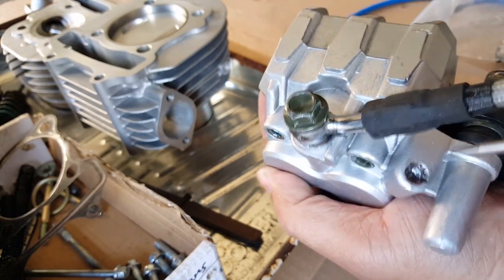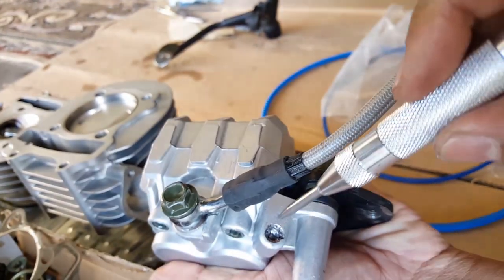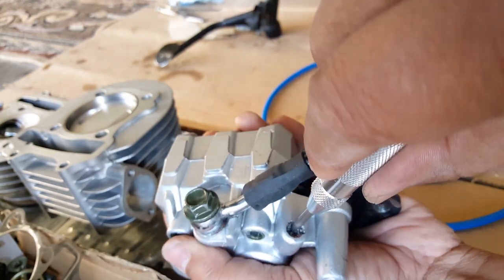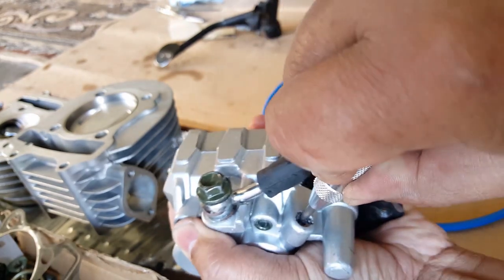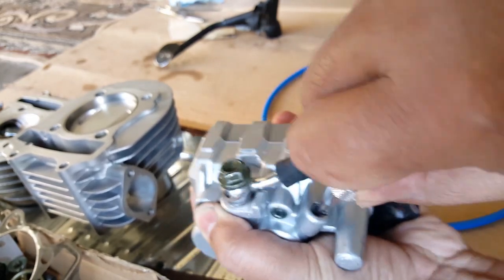But what you would do is, you'll grab a center punch tool like this. I didn't see how useful one is. So you see it retracts back and forth. When you push down on it, you'll see it click. That click mechanism is like a spring inside. See, like that. If you do that enough times, it'll start making indents deeper and deeper.